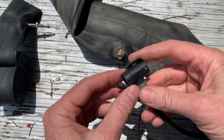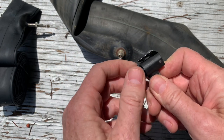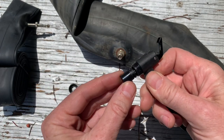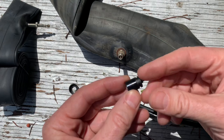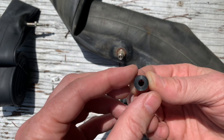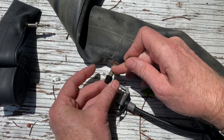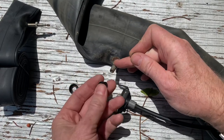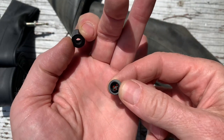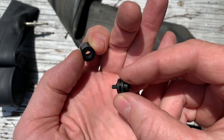A lot of these pumps, if you take them apart, you can switch them back and forth. To do that, twist and unscrew counterclockwise, then take the guts out. You'll see there are two pieces — a plastic piece and a rubber piece. There's a small hole for the Presta valve. To fit over the Schrader it has a big mouth end and a small mouth end, so you put the big mouth end towards the outside.